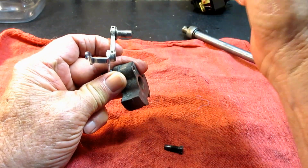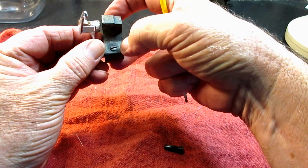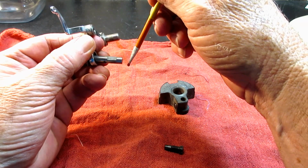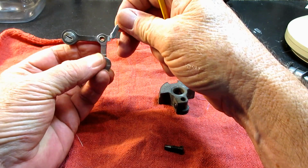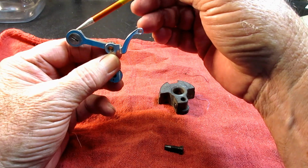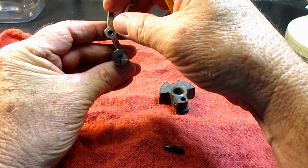But by me concentrating on fixing the play on this, I totally just forgot that when I tightened this set screw, I had moved stuff around and it wasn't on the flat spot anymore. So that's why in the pictures that Harlan sent me, even though the needle bar height was perfect and the timing was perfect and there wasn't any play or binding in my Spartan anymore, I had changed the position by not being on the flat spot.